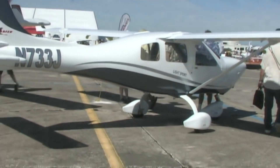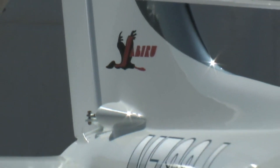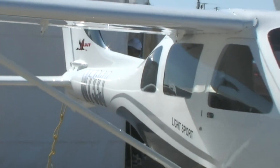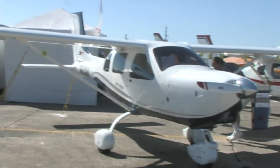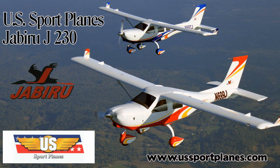With the storage capacity and everything, this airplane must make a great cross-country flyer — but what kind of durations or distances could you travel? Well, for one, it holds a lot of fuel — 36 gallons — and it burns about five to six gallons an hour depending on how you're operating it, so that translates to seven or eight hundred miles of distance. Frankly more than I care to go on a single stretch, but some folks will love this airplane for that reason. I have gotten to fly this, and there's also a 170 version — a smaller two-seater model. Both are available on my website at danjohnson.com.